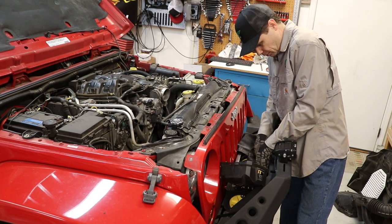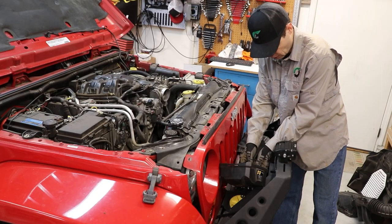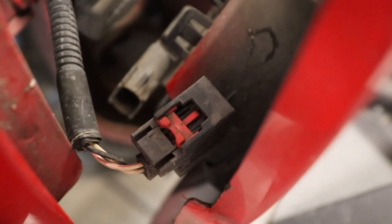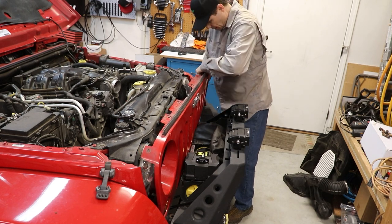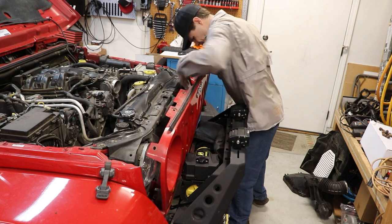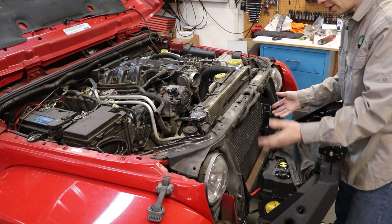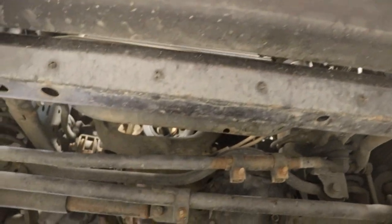I really didn't want to have to mess with the wiring on my winch. I have this one red wire coming through the grill, but just for filming and ease of doing this job, I decided I just need to go ahead and remove this red wire so I can pull this grill all the way off. Now with that wire out of the way, I can disconnect these turn signals — push that little red tab back and push down and it should slide right off. On this one the tab is on the bottom, so a little counterclockwise rotation of the bulb and it should just pull right out. Now my grill is disconnected, and one more little cover to remove here.